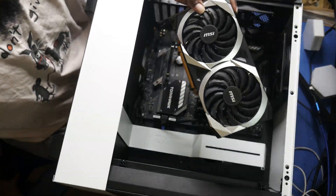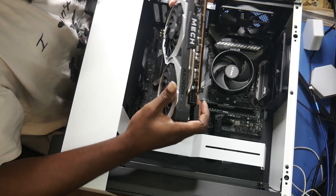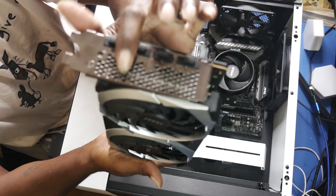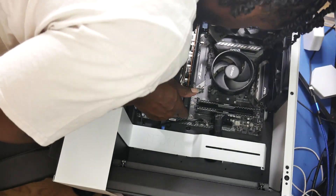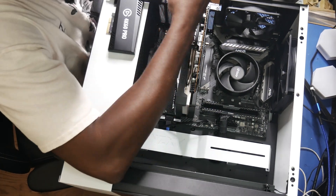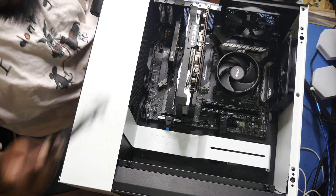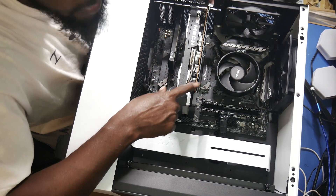I did a lot of saving to get this. Comparing the two, the new one is way bigger. As I'm installing it I notice it's going to take up two slots, so I'm removing one of the expansion slots and adding it in — you can see it is wider. I pop it in place and it just snaps in. Next is the capture card — it only takes up one spot. I'm removing the panel right above the PCIe slot and tightening it down. Everything looks good so I'm closing her back up, and the last step is connecting power to the GPU.